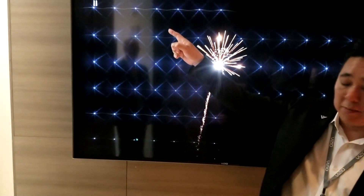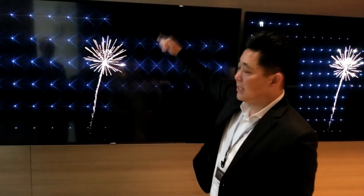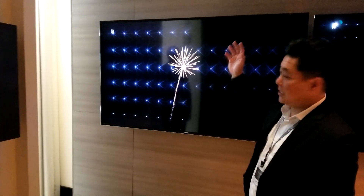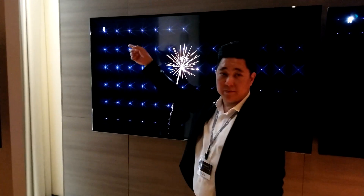The reason we did that is to show you actively what's happening with our local dimming within each series of products. If you look here as the content is paused, one of the clearest things is that pause icon up in the top left-hand corner. With E series, on this particular 65-inch set, we have six rows of LEDs and two columns — so this is a 12-zone system. The top right-hand zone is actually off because there's no content there, while the top left is on because of that pause button.